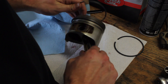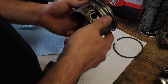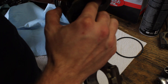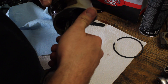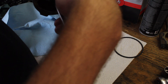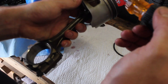Trying to put on the bottom ring first, it wants to go in the top ring groove, so I have to move it down one more groove — but I didn't want to force it all the way down because it might break the ring. I was able to move that ring all the way down and I'm going to use a screwdriver to properly move it around.